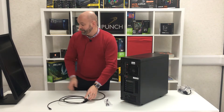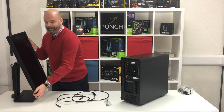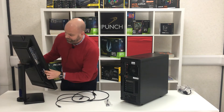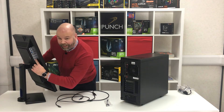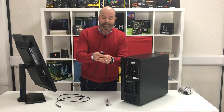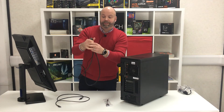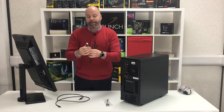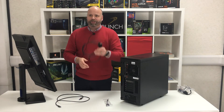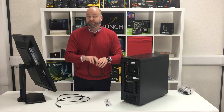The next big misstep is people setting up their monitor. The most common connection types now are either HDMI or DisplayPort. DisplayPort is always our preferred connection type and although it looks similar to HDMI, only one of the edges is chamfered off. It's a high bandwidth connection that actually lets you have multiple monitors run from one cable if you wanted to — you can daisy chain them. Generally, as we do an awful lot of photography, video editing, 4K gaming, and high-end systems, DisplayPort is your preferred connection method.